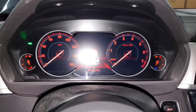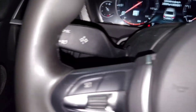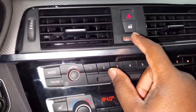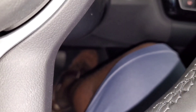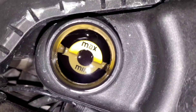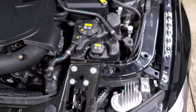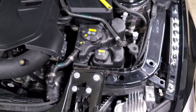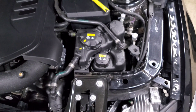Then we do the process inside the car to manually activate the electronic water pump. Get in the driver's seat, turn on the battery — don't actually start the engine — then turn on your headlights (don't leave it in automatic), turn your heat to the highest setting with the lowest fan speed in manual mode (turn off auto), then turn on your hazards. After that, hold down the accelerator pedal for about 15 seconds. You'll hear a small buzzing sound — that's your water pump running. Look inside your coolant tank and you'll see coolant moving. This runs for about 10 minutes and you might need to do it two or three times, keeping coolant between the minimum and maximum line.